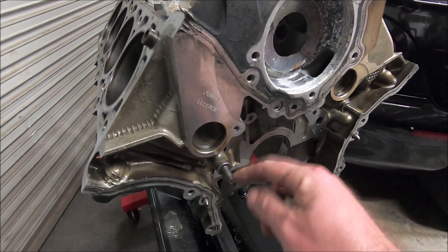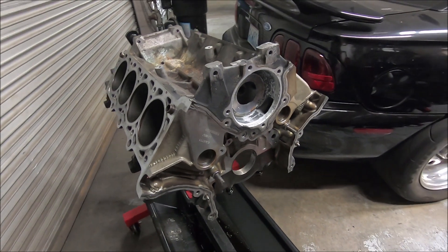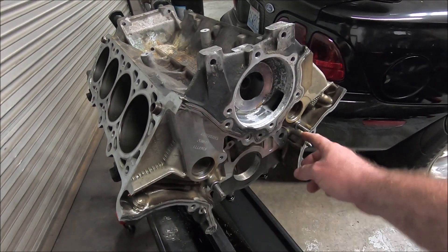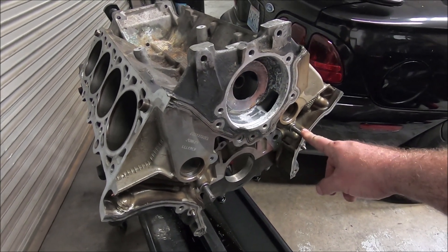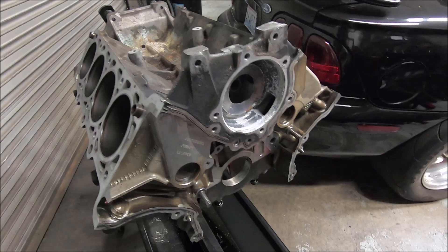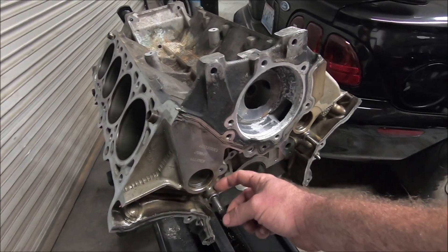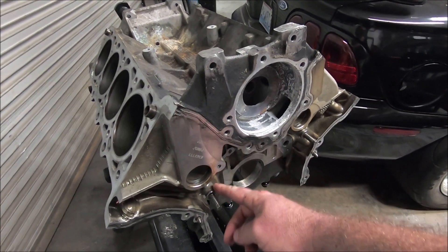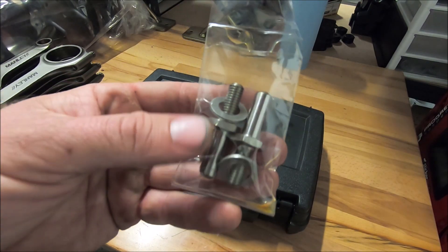In this video I'm going to be upgrading these pivot pins. It's a similar process on all the aluminum blocks. All the aluminum blocks came with threaded-in pivot pins, which are a known failure point. I'll show you when I pull these out and compare them to the new Cobra Engineering pivot pins we got. I have not done this on an iron block — the iron block ones are pressed in rather than screwed in. Here are the pivot pins from Cobra Engineering.